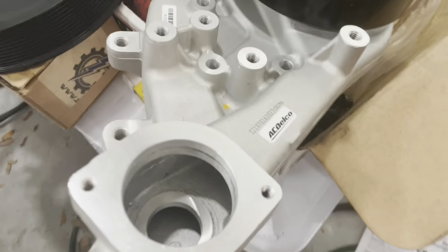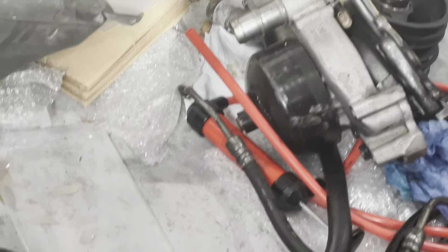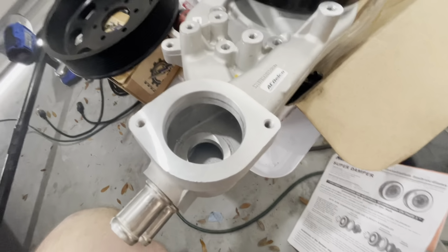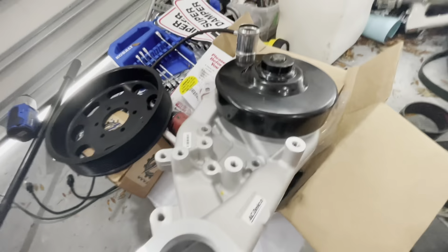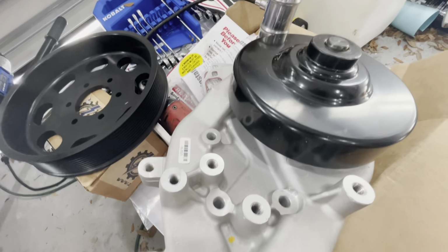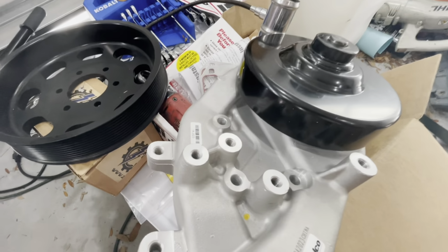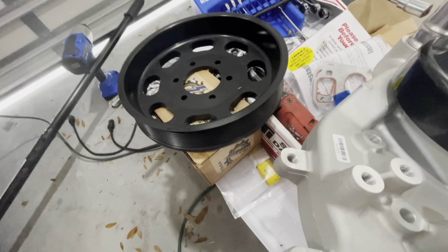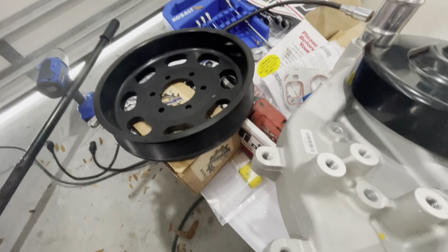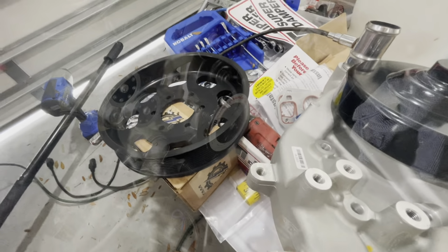All right guys, for the water pump. Well, I thought I had the right water pump, but I must've bought an LS1 pump when I did the install. So actually I didn't have the right water pump. You gotta have a ZL1 stock water pump there. So I went ahead and bought one. Actually, I got it from Greg at LSX Concepts, and we'll put this on that. I think it's gonna be all worth it. Again, there's the pulley for the blower. We're gonna bolt that on. There's 3 bolts, and pretty simple there. So we're getting close, guys.